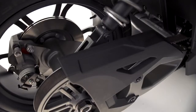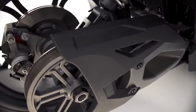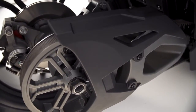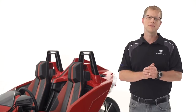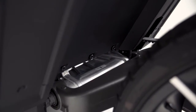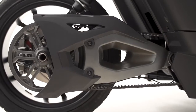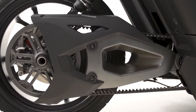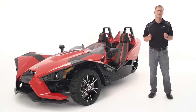The rear wheel connects to a motorcycle-style single-sided hollow cast aluminum swing arm that attaches to the frame via a single pivot point. This allows free vertical travel, soaking up the bumps. The wide pivot point of the swing arm links it securely with the frame, eliminating lateral flex between the two components. The design of the swing arm keeps the rear wheel locked in the same longitudinal or roll axis of the frame.